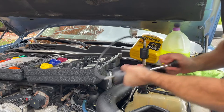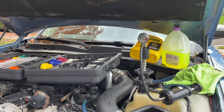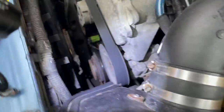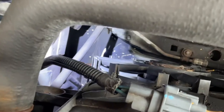I'm almost at 10 PSI. I actually see my liquid level going down already, so it is leaking somewhere. I'm not even going to bother going more — I'm at 12 right now. Now we grab our light and start looking. So that's where the thermostat is. The upper hose looks good here. We already see the leak — it's down there on the bottom of the radiator, right where the drain plug is, the drain hose. I wiped the whole bottom and I can see liquid clearly coming out there now.